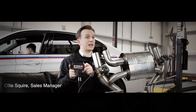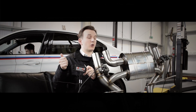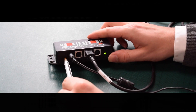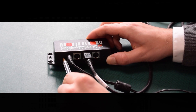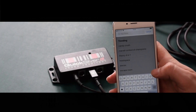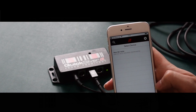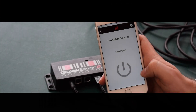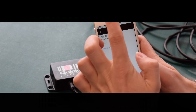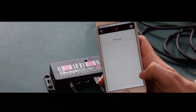Next, you're going to set up your Sound Architect to pair with your phone. As a safety measure, you have to ask the Sound Architect to pair — this stops anyone outside your vehicle from being able to log in. Take a pen, press and hold this little button inside, and with the green light flashing your Sound Architect is now available for pairing. Go to the app store, type in Quicksilver Sound Architect, download the app, and your device is ready to pair. If you experience difficulty connecting or have an older device, you may need to toggle legacy mode — tap the arrow top left, hit settings, and use the legacy mode toggle. Even a newer device can default to older Bluetooth protocol if influenced by existing pairings, such as a car stereo. Once you've re-scanned, legacy mode has you covered.